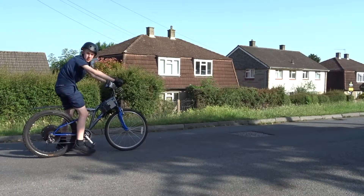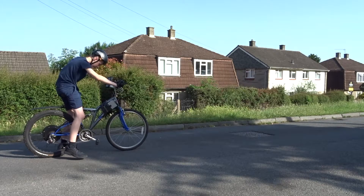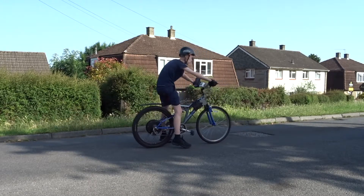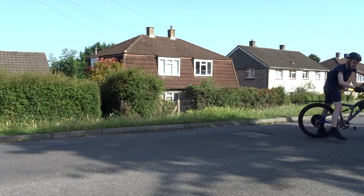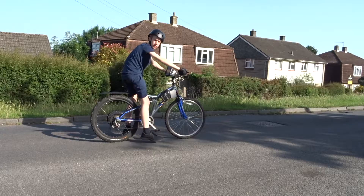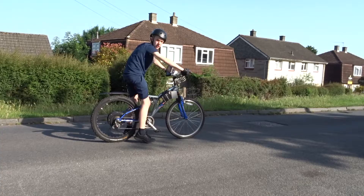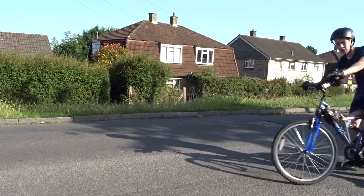To demonstrate this more practically, I have the bike in sensorless mode so the sensors aren't doing anything. If I try to go from a standstill — it works, but the bike struggles to get off. You can also notice the tone of the bike. Now with the bike in hybrid mode, the sensors are working at low speeds but not at high speeds. It's hard to show on camera, but if I twist the throttle, it starts off a lot easier compared to the sensorless mode, and the tone is also different.